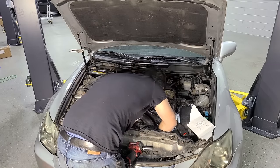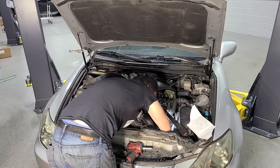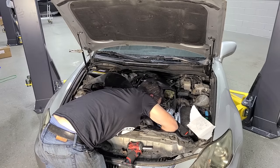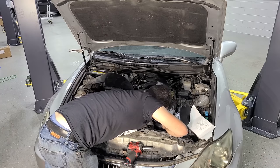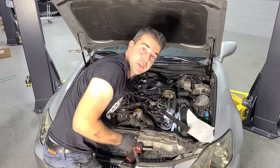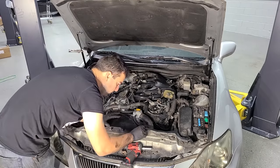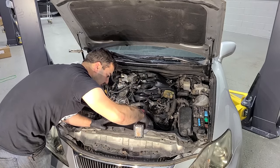So we're going around the water pump, under the idler, over the alternator, around the AC compressor, around the crank, and around the tensioner. I said around the tensioner. Get around there. We got it. We're good. Belt installed. All right. Okay, we'll throw on our factory cold air induction kit here. Only came with one bolt, but I think that's gonna be enough. There we go.